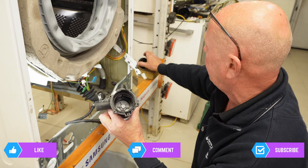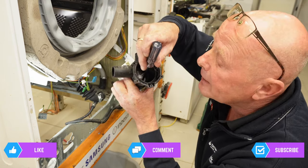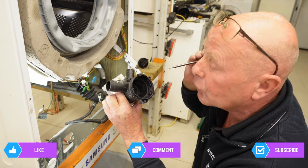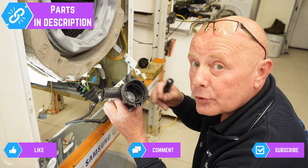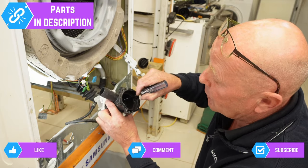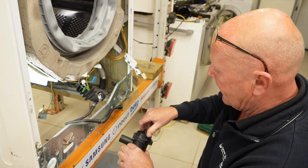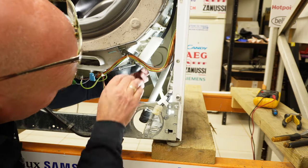I promised to show you the impeller — let me quickly take this off and bring it up to the camera. The impeller turns and it's a magnetic pump, meaning it has resistance on it and feels notchy, but that's just the normal action of the pump. On earlier models they just had an AC pump which was very free and would turn automatically. This is an AC pump but it's a magnetic motor pump, meaning it's got three points where it catches the magnets and becomes clunky — but that's a perfectly good pump.